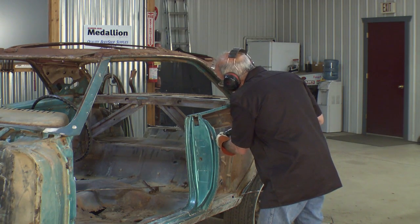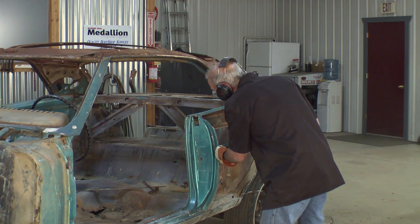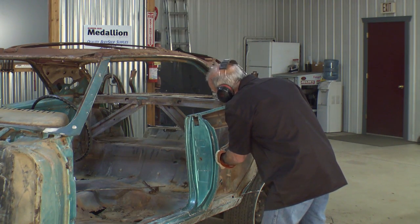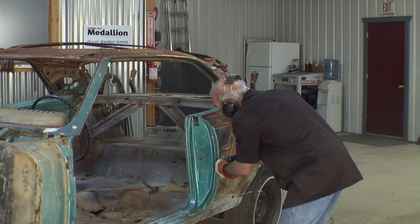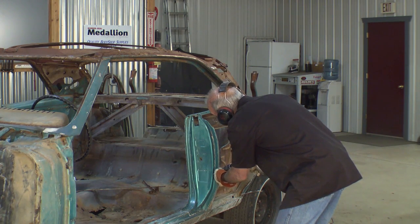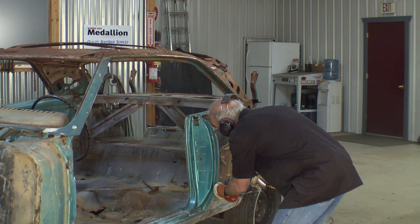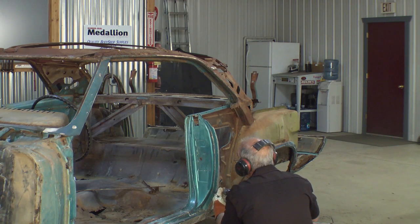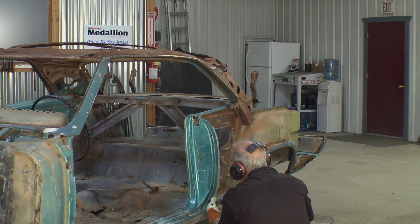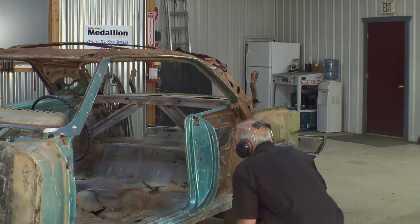Watch the chisel pierce the door jamb again. The object is it's spot welded to that face and I have to have a single plane of metal, but the caution here is I'm barely piercing — because if I continue to chisel in, it'll hit that inner structure piece that carries the door latch. So very carefully working along down there — that's what you're going to do: practice with the chisel. That'll put that face in a single plane and allow me to roll that metal off and push it over the spot welds.